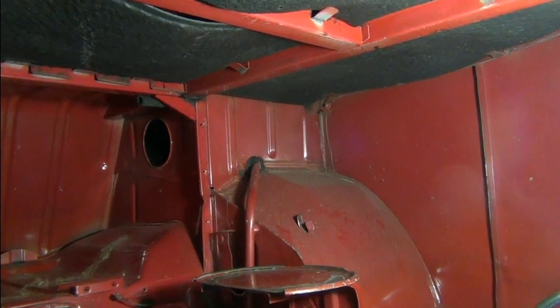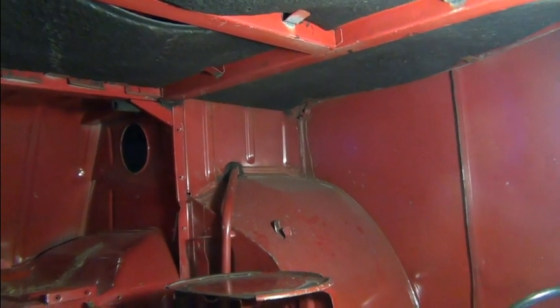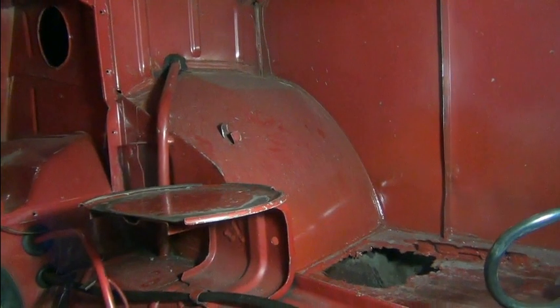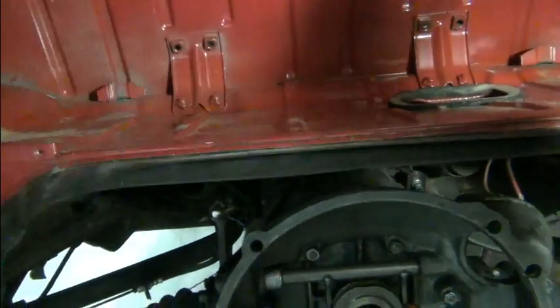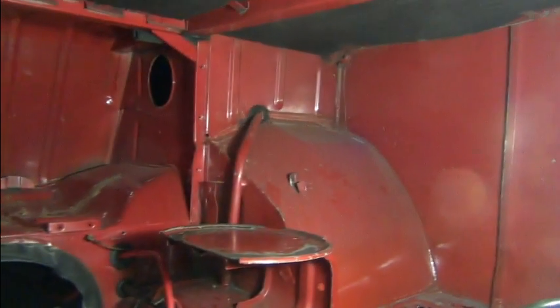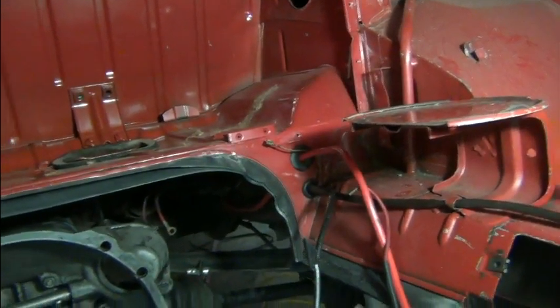That's why we put the charger there, otherwise we'd have to run the wiring to the other side. There are five wires: your two hots, your ground, and your pilot and proximity lines that come from the J1772 charge port. Our main disconnect and electronics will go on a box that sits right on this pedestal here. Our main component board will be positioned here with the inverter, throttle, main contactor, and all that, and then our relay board will be on the sides along with our coolant reservoir on this side.